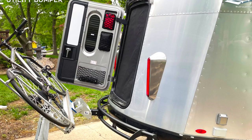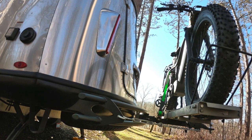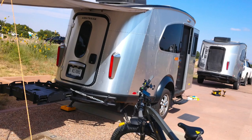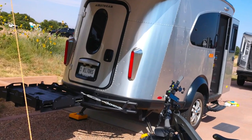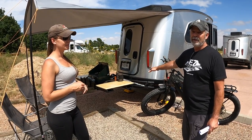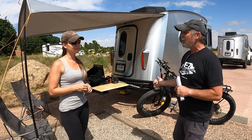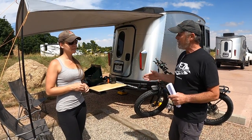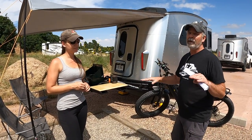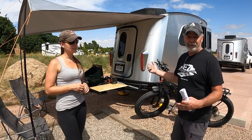Mountain bikes, traditional bikes and carriers — no big deal. When you start getting into the two heavy e-bikes, you've got to be careful with your weight. I carry an 85-pound bike and a roughly 52-pound carrier. If you start putting more than that, you're going to start messing with your tongue weight. If you start to get some sway, you need to load weight in the front. With mine, this keeps my trailer tongue weight at about 10%, and if I need to load a little more cargo in the front, I do that.